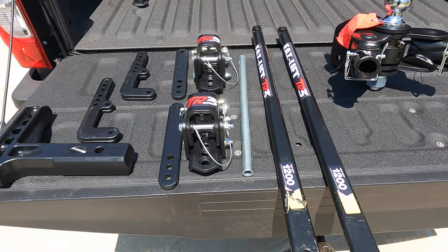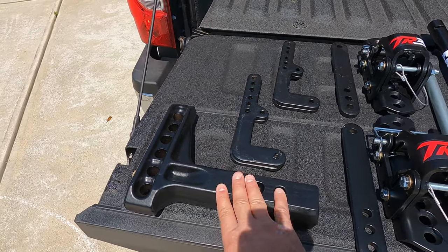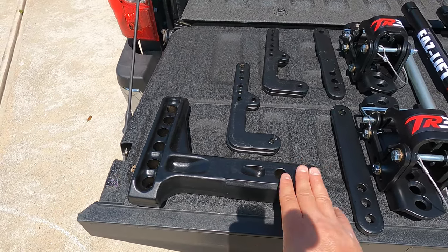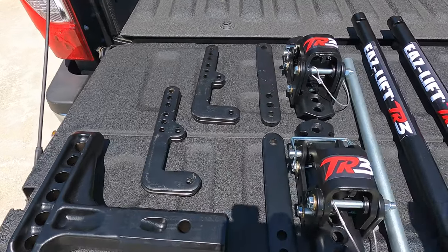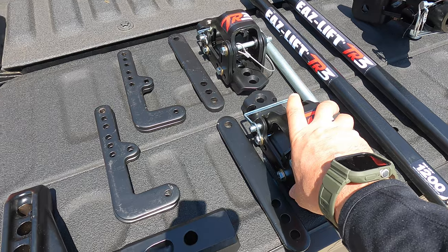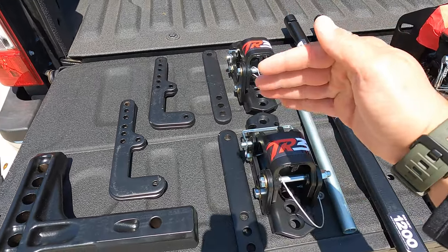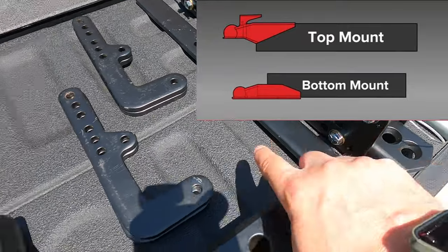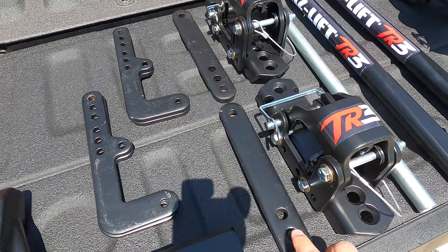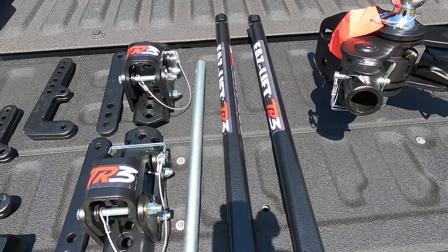Let's go through the parts real quick. I've read the instructions and watched a short install video — it's really quite simple. You've got your shank here. They sent me a two-inch shank; I'll have to use a sleeve on this. I'll link it in the description box below. Here are the saddles that go onto the frame of the trailer. These are extra brackets — right now this is set up for a top-mount trailer. If you have a bottom-mounted trailer, you'll switch these parts out, and they're already included, which is kind of nice. Here's your cheater bar — they call it a lever bar, I call it a cheater bar, I'm from down here in the South. And here are your bars.